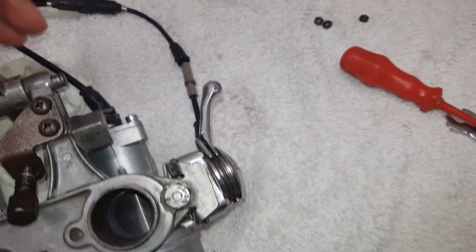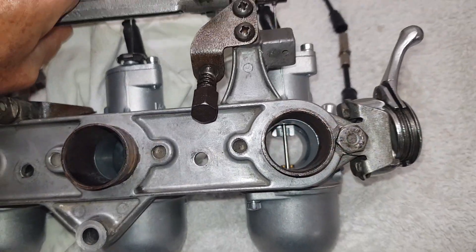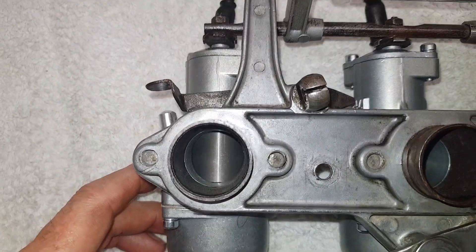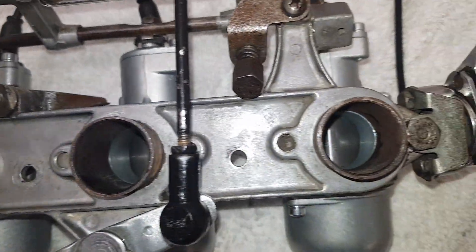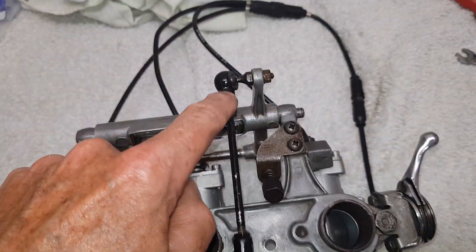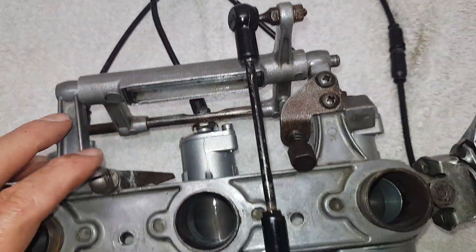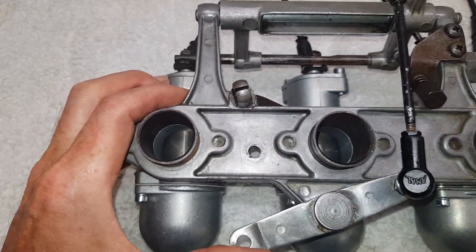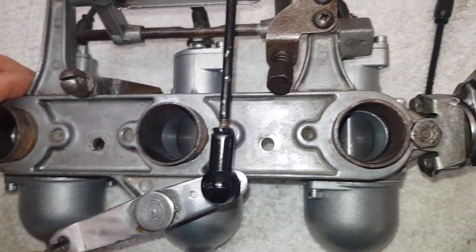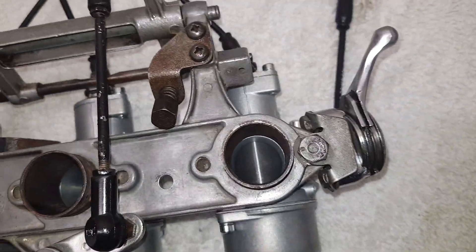To make sure that when the choke is fully off it is actually free and off. I think we're synchronized and ready to go now. The lock nuts are on the throttle rods and I've connected the linkage, just checking that everything does open at the same time - unlike the issue on my one - and it's all smooth.